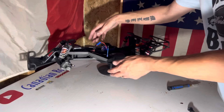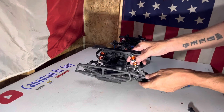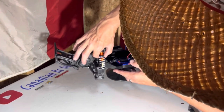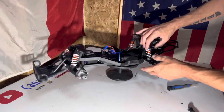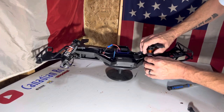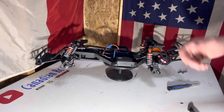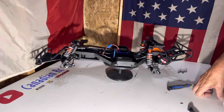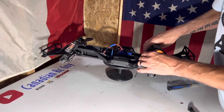For the right rear shock collar, we're gonna crank that one halfway down. You can see it's not quite halfway down, so we're gonna crank it a little bit more — about halfway down. Then on the left side, we're just gonna crank this one all the way up to where the spring is still tight, since our springs aren't quite long enough to go all the way. We do have another set of springs coming for this thing. So on the left, we're just doing it so the spring has no movement and at least has some good compression — it's gonna hold it in place.